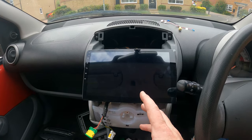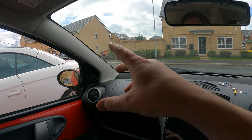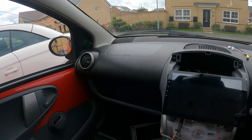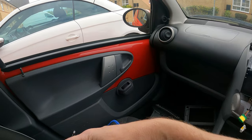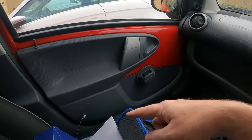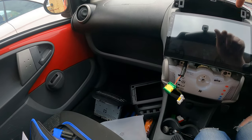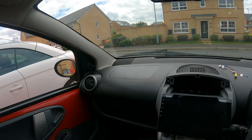Now what we'll do is route all the cables and everything that needs to go to it. We'll start off probably with the DAB antenna, which is going to go up there because I've got to get through that A-pillar, bring it down around behind the dash and into there. Then we'll jump to the back of the car and bring round the reverse camera feed — I'll probably run it along the bottom trim underneath the carpet, just by the doors, because I think that's going to be the easiest route up around that corner panel behind the dash.